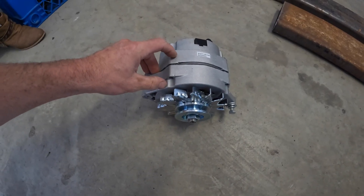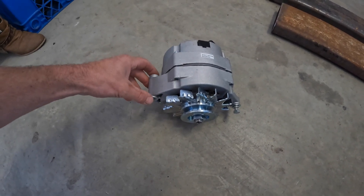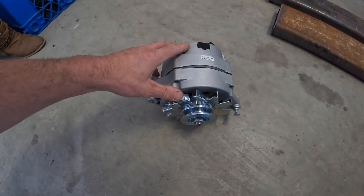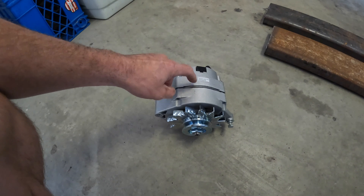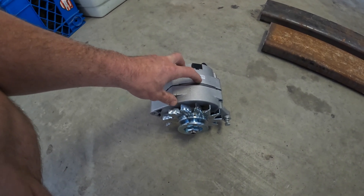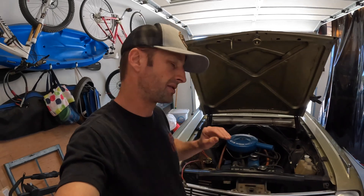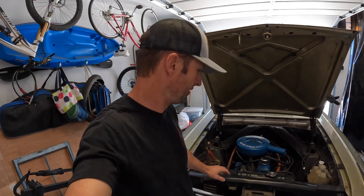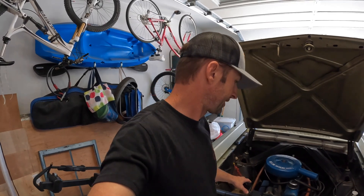There are a lot of different alternator models people use to do one-wire — you can use a 10SI, 12SI, a CS series like a CS130. I think I've done this conversion with all of them over the years, even put a CS130 on a motorcycle once. But the 10SI is going to work great for this car — 80 amps is more than enough for the few electronics I'm running. Normally you'd start with a disclaimer to disconnect the battery, but because this car tried to catch fire the other night, we already disconnected the battery and took it out of the car. I'll charge the battery while I work, and I'll just get to disconnecting everything.